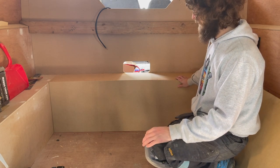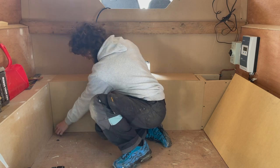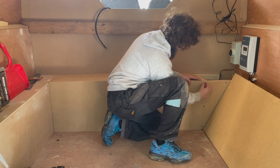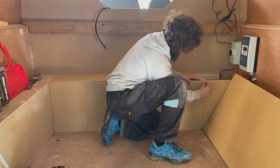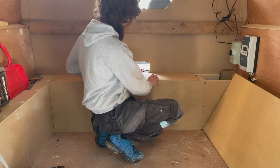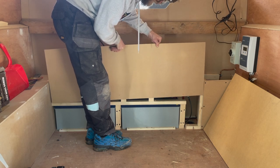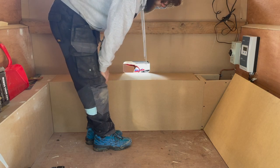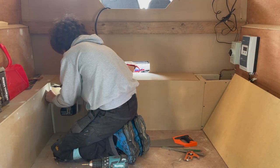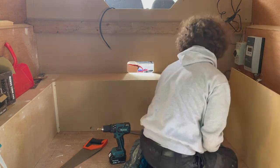So what my plan is now - I've got this little thin batten and I'm just going to fix it down the edge along the bottom. Then with this here I'm just going to fix a piece which will overlap half and half, or just a little bit, and just go down there. The idea is this will have handles on and it will be able to slide up so you can get into your batteries, and then slide back down just like that.